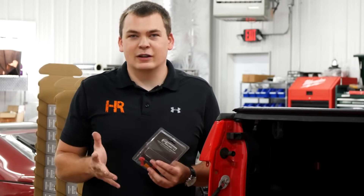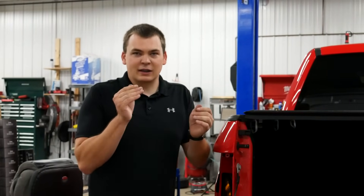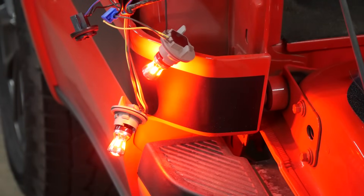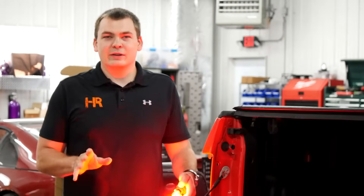In the hundreds of resistors that I've installed both on this YouTube channel and in my personal life, I've never had one go bad — they just don't fail. So if you get this whole thing installed and you've still got fast blink or something weird going on in the dash — fast blink on the inside and a slow blink out here — make sure your wiring is properly done. The biggest mistake people often make with resistors is connecting the turn signal wire and the parking light wire, or the ground wire and the parking light wire — that just won't work. It needs to be the turn signal and the ground. As you can tell here, they're bright and, more importantly, they're not blinking quickly — they're blinking the exact same speed that they should be.